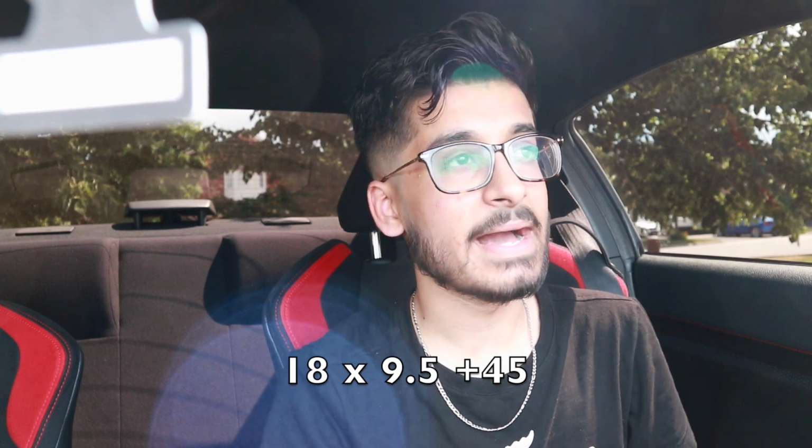Now here is where we run into a little bit of an issue. My car, as you guys know from the previous video, is on Eibach lowering springs. The wheel setup that I'm running is 18s by 9.5 with a +45 offset. I did calculate it and it was a really tight fitment. Once we put on the wheels, the rears fit perfectly fine, but we ran into a little issue with the fronts. The fronts were actually touching the strut of the lowering springs.